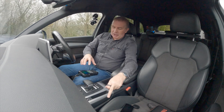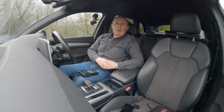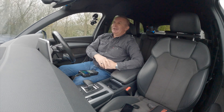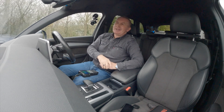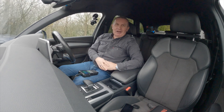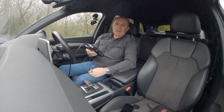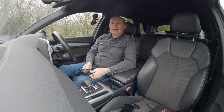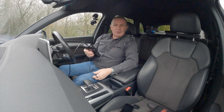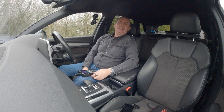I plugged the other diagnostic tool in — this one hadn't arrived yet — and it took us straight to the oxygen sensor. We replaced it and that was it. Me and John are a bit creaky now and don't like bending over bonnets, but even we can use this stuff. It's an absolute godsend and cheap enough to just have in your toolkit. Thanks for watching, and thanks again to ThinkCar — I really appreciate it. See you in the next video!